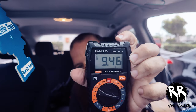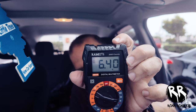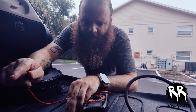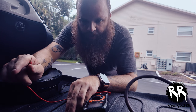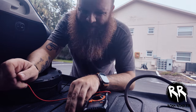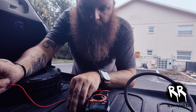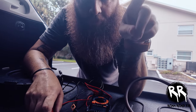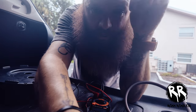I'm not sure if you can see it but it's kind of jumping around — I don't have a perfectly stable connection to the terminals but I know it has power. Since the car is not running, the batteries aren't connected because the DC-to-DC charger is only activated by the fuse power when the car is running. So the power at the output end should read nothing, and it's at zero. Now I'm going to start the car — when I come back it should read between 12 and 14 volts.